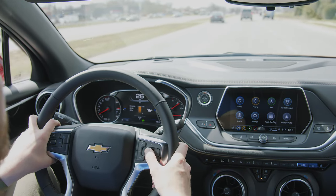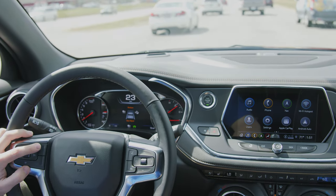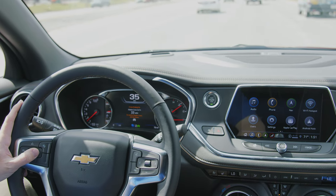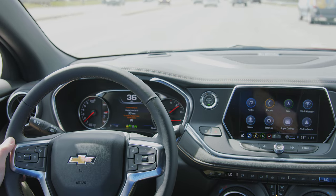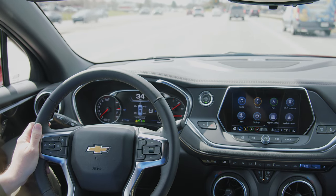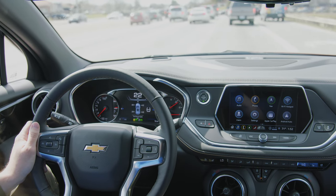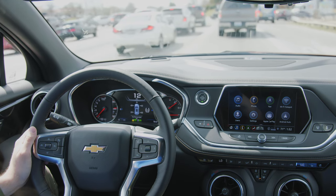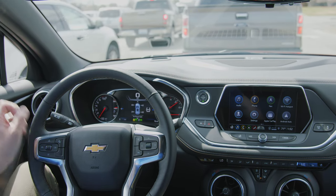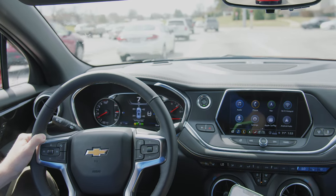As far as safety systems and driver assistance features go, let's test the adaptive cruise control. You can adjust your gap distance using this button here — we'll set it to medium and go ahead and enable the adaptive cruise. Cruise braking is on, so it will start to slow me down if I get too close to the truck in front of me. You can see it's already starting to slow me down — it should bring me to a full stop once I get close enough, and I'm not applying any brake pressure. This is all the vehicle doing it. And there it is — brings me to a full stop. One real test is whether it speeds me back up, and it does not look like it's doing that, which is unfortunate.